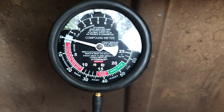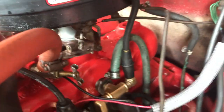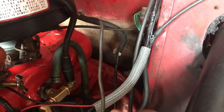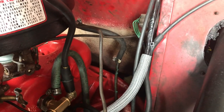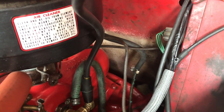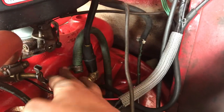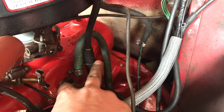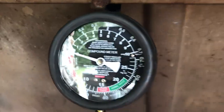All I do is have my vacuum line run into manifold vacuum. You don't want to run the vacuum off of where your distributor gets its vacuum from, because that's technically a restriction — you're not going to see the full vacuum that you would otherwise. Obviously here's my intake manifold, and there's a nipple in it, and I have my vacuum hose running directly from that. I just hung it on this cross support on my hood.